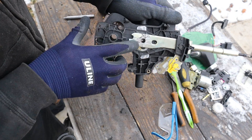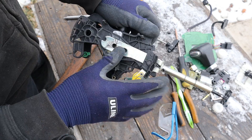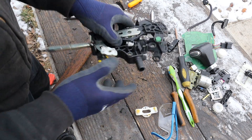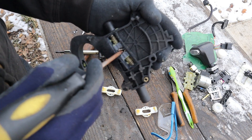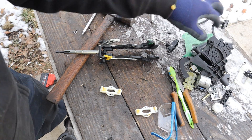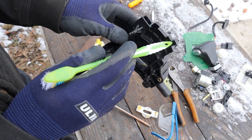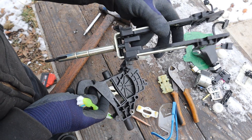So here's where you can kind of see that dual pivot axis — if you lock this to this, it all becomes one piece, whereas if you unlock it, then you could just move the rod itself alone. That's what allows you to change the manual shift. Inside of this arm here you can see there's this white piece which is the slide for it. Here's the little slider for the pin in the middle, and there's also one on this side. Now for the manual shift, you can see there are these two springs here — they're going to move back and forth, and that's what's going to give you that springiness to bring it back to center when you're manually shifting. So at the bottom we had that spring with the detents for the nice clicky feel, in the middle were the springs for your manual shift, and at the top is the park, reverse, neutral, drive lockup with the little fork inside that moves.